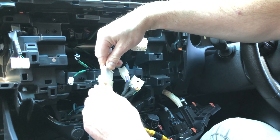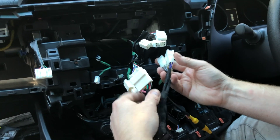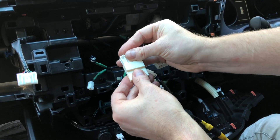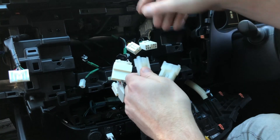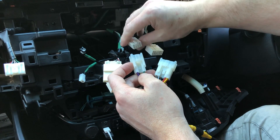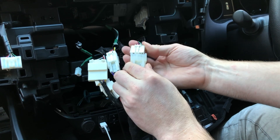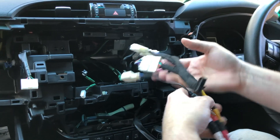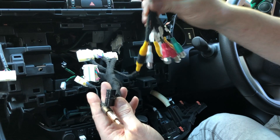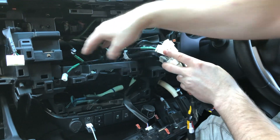There's a small six-pin plug which is your rear speaker sound, and next to it a 12-pin plug which is your power and front speakers — those are your main looms. These all plug into the new stereo: the main power harness, AM/FM radio, RCA outputs, camera inputs, and the auxiliary input. That covers all the main looms — all very easy to do.